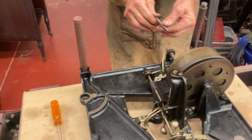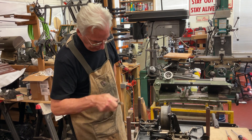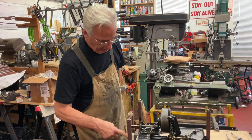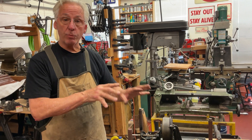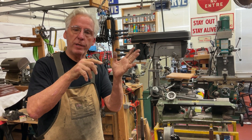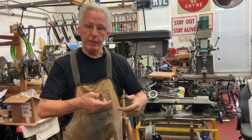Now the big test before you pull the motor apart — you're gonna crank it up. And that's extremely light. That feels to me like it has a broken spring, and it probably does. You don't hear any metal working, you don't hear a slip on the outside of the spring or the inside — you'd hear that metal.